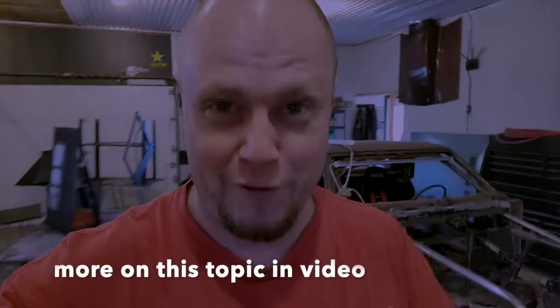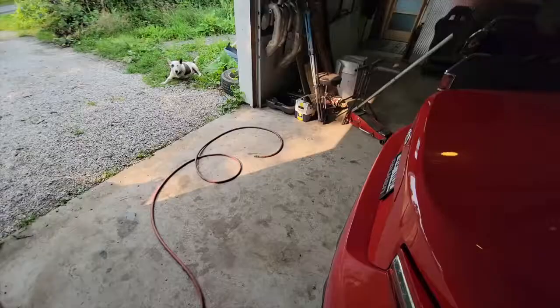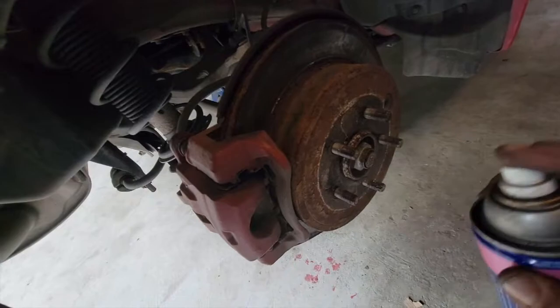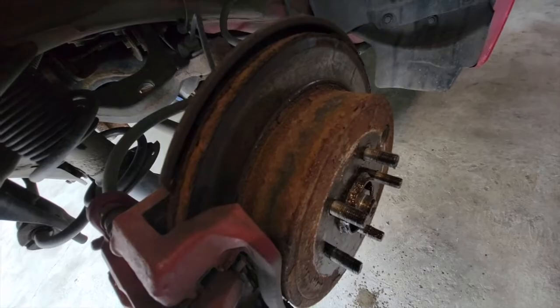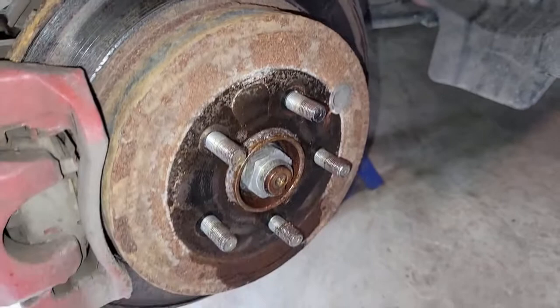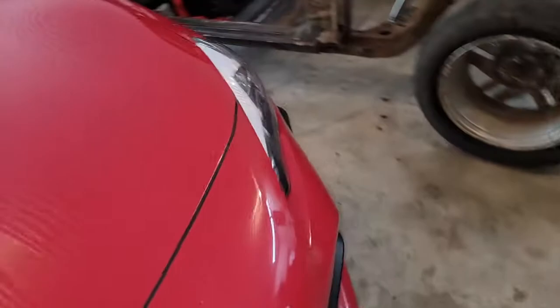I have to be completely honest with you guys — I did not have a good time filming this one, I did not enjoy making this video. First things first, we're going to jack your car up on some jack stands for your safety. This is not an old car, but it has 74,000 kilometers on it and she drives a lot in the wintertime. I just want to throw a bit of WD-40 on the center hub here so that when it's time to pop this off, hopefully it won't be so bad. These brakes are scrap anyway — they're pretty torched, pretty nasty for a 2017. A little spray up front and back, all around, just to try to make our lives easy. It doesn't matter if we get any kind of lubricant on them since we're changing them all. I'm going to clean the rest after.